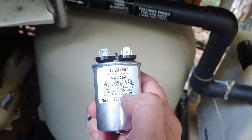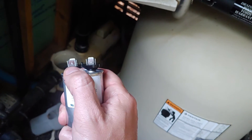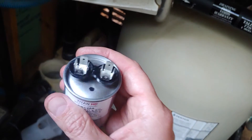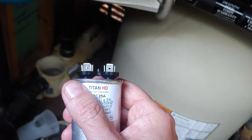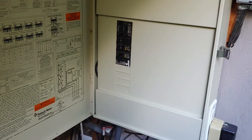To replace your capacitor, match up all the stats printed on it and you'll be good to go. On this motor it's a two-speed motor — there are only two wires. The black wire was on the right side and the brown wire on the left. Take the two screws out, one on each side, remove the cover, put your new capacitor on, and slide the wire clips onto the contacts.